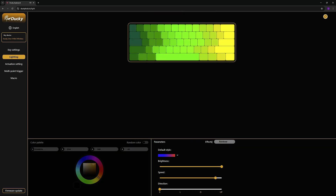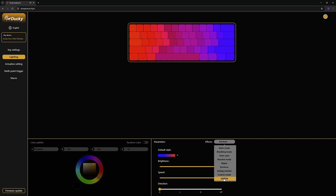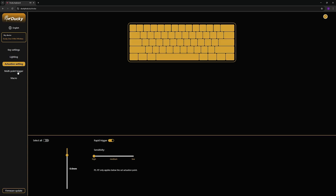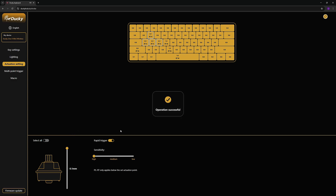On the lighting page you can configure RGB effects, though luckily there is a setting to turn the lighting effects off, which I much prefer. On the actuation settings pane you can adjust the actuation distance between 0.1 and 3.5 millimeters. It also has a quite lackluster rapid trigger slider with only three modes — high, middle, and low — which I think they should change to the same kind of continuous slider found on pretty much every other rapid trigger keyboard. The rapid trigger at the highest setting still feels quite nice and responsive, but I would hope for more customization.